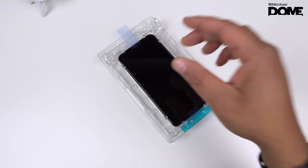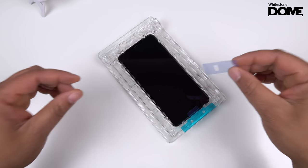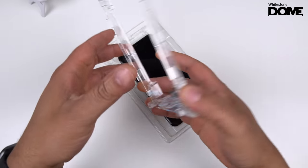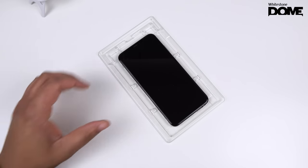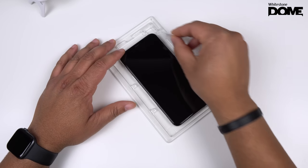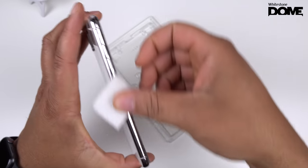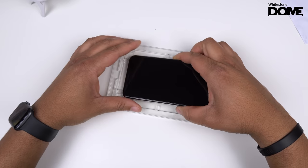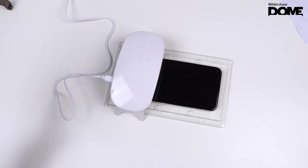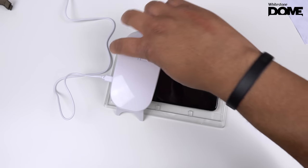I did 15 seconds for each layer — top, middle, and bottom. Now let's remove some of this stuff and set up for our final curing process. Move off the frame carefully, because some glue may have come out. Clean up the sides a little bit — that's why I say keep that alcohol swab handy. Just rub the edges down. Keep that alcohol swab and clean it off a bit. Bring the UV light back and do 30-second sessions: top, middle, and bottom.